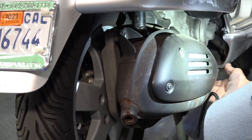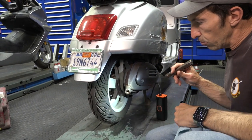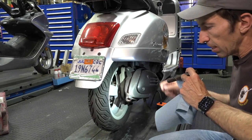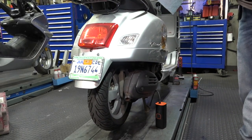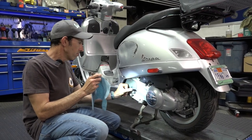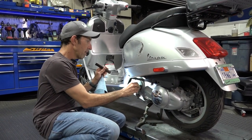The oil filter looks nice and clean and is not leaking or loose. Then we'll go to the left side and check the oil level — pretty important. Of course it's on the center stand on a nice level surface; that's always the best approach when doing an inspection of your scooter. The engine's cool — you get the most accurate oil level reading with a cool engine.